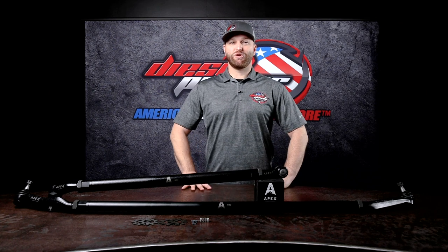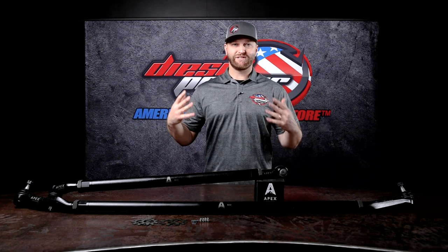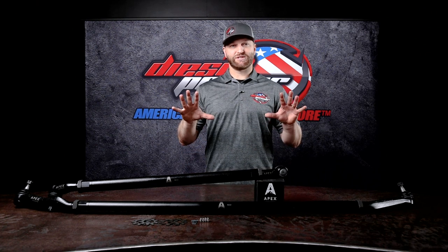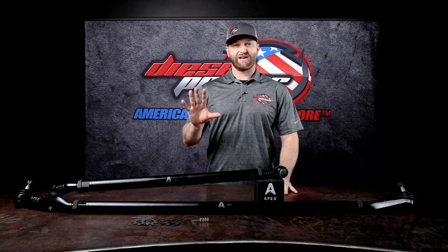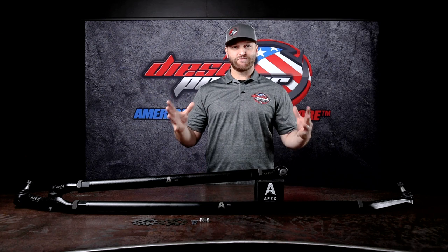So let's talk about the important notes on this as far as fitment goes. Again, in the beginning of the video, we talked about this is gonna follow the same rules as the Mopar 09 T-Style steering as far as fitment, but as far as other aftermarket parts goes, I know a lot of people have upgraded their factory track bars and gone to a different brand. One thing to note here is at this time, this does not work with the BDS adjustable track bar. It may in the future, but at the time of this video, it does not work with that. If it does, check the important notes and we'll put that in there for you.